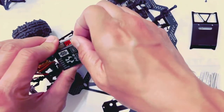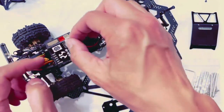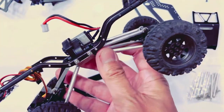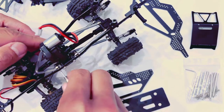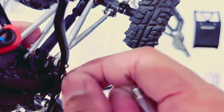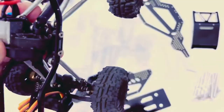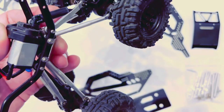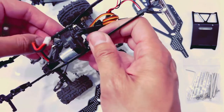Remove the motor wire as well. Ideally you don't pull it by the wire — pull it by the white connector if you can get a good handle on that. The only thing left to remove the chassis is going to be these four screws, so we're going to do that on this side as well as the other four on the other side. The outside ones are going to be longer than the inside ones — just make note of that for when you put it back in. The inside ones are shorter. Now that those eight screws are off, this thing should come off.